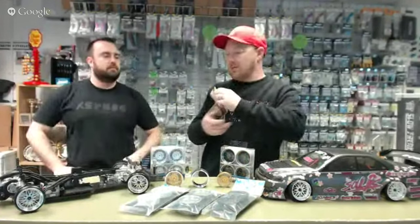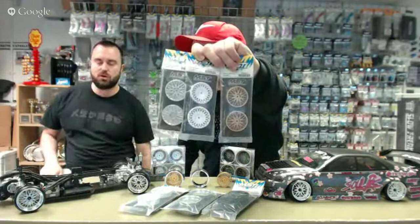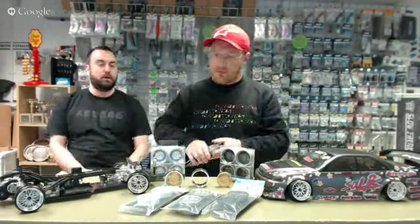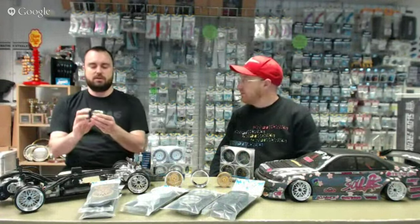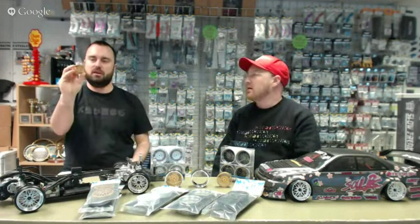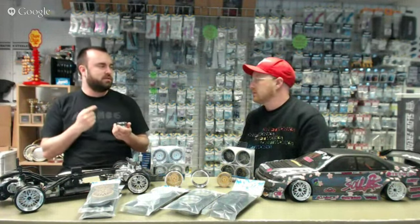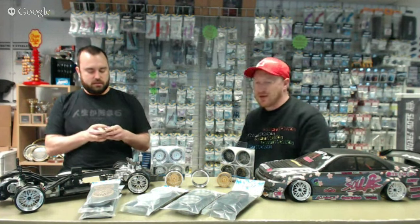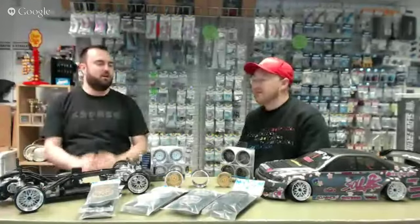These aren't all the colors — there are far too many options to show here, but they're all listed on our website and all in stock. Every option currently available. There are also two new designs teased by MST this week: style 21 and style 106 — both look pretty awesome, and we'll have them in as soon as they're available. As for how they work: you've got four notches on the rim and lugs on the edge of the centre. You select your offset — for every single set you can do 3, 5, 7, or 9mm offsets. Officially, you should glue them, though I haven't had to so far running rear wheel drive with less load.